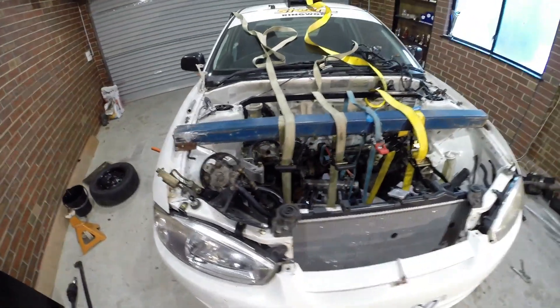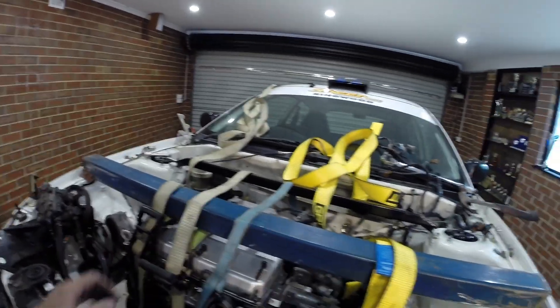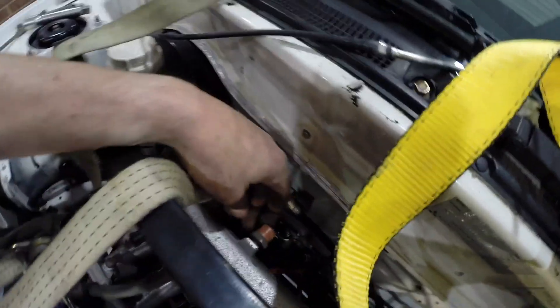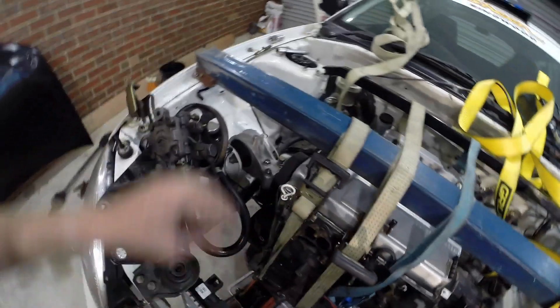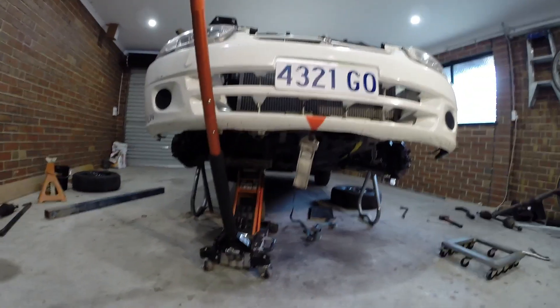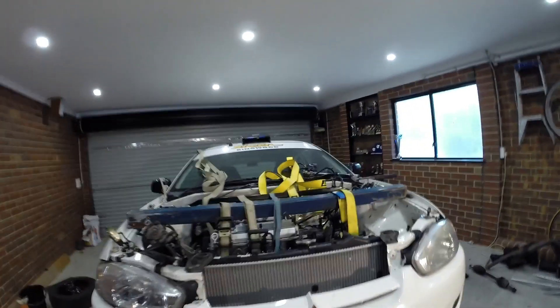Well I hope that's handy for you. So that works rather successfully. It definitely needs to have four straps put across the top so you can actually adjust them as you go up. One thing I failed to do was I failed to take one of my little plastic sender units off the car and I've snapped that off, so I'll have to replace that one. But apart from that I've done pretty well at making sure I've missed out on hitting any of the electrical connections or anything that were on the car. It came up and then obviously you thread it in through your joints — keep them loose whilst you're doing it so that you can just move them around quite easily into place. I had to use my jack to assist it just at the final stage, but it only took me about 20 minutes to put the engine back in the car — a pretty good result.